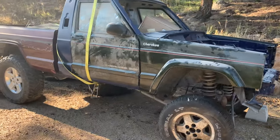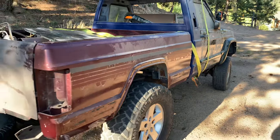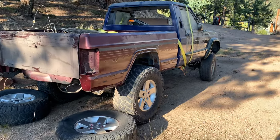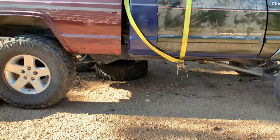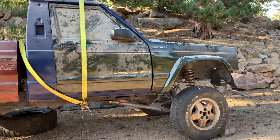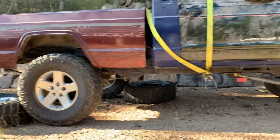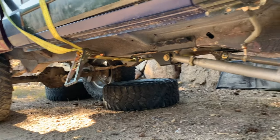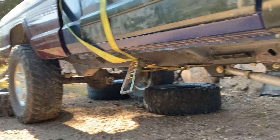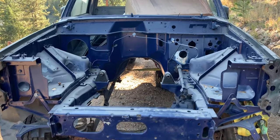I'm not entirely sure what year this was originally. I do know it is an 80s Comanche. I have to look into it a little bit more, see what years they made them. Essentially what we're going to do — this is literally a cab. This is from a late model 90s Cherokee, which I'm going to do the front-end conversion and late 90s interior conversion on. It's got the original bed. These aren't full-framed trucks — they're essentially a half rear frame into a unibody front end, which is kind of weird and interesting. It's a crossbreed between a truck and a Cherokee.